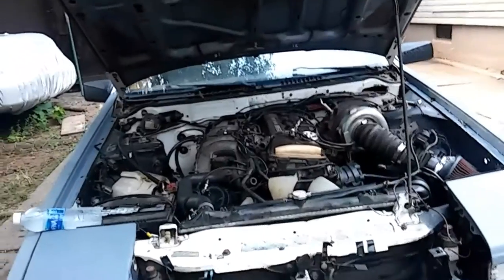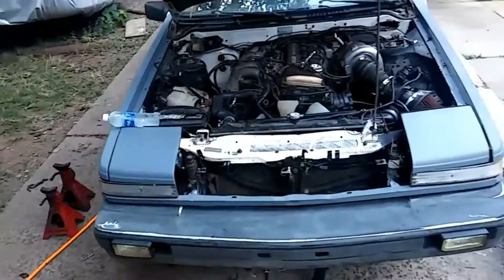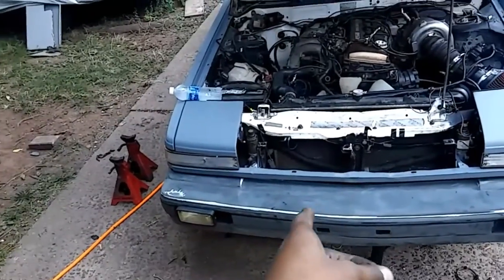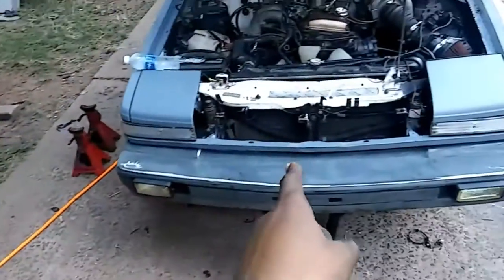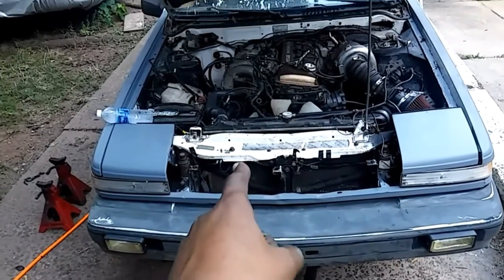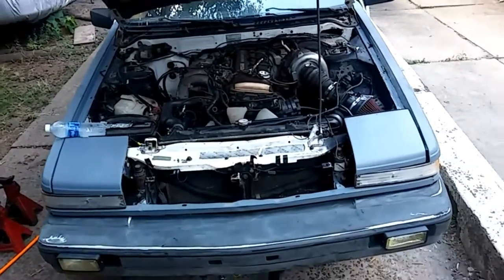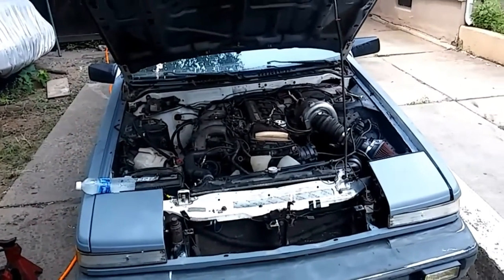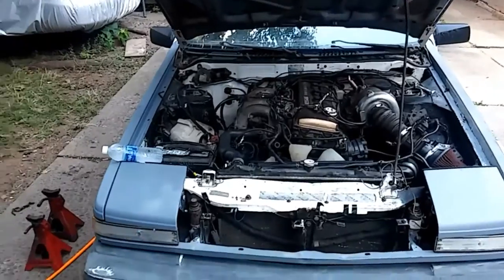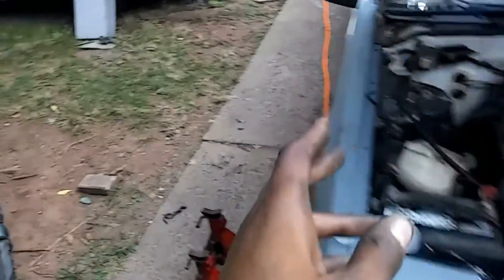Hopefully this goes well. I should be able to jack up the engine a decent amount once I put the stands underneath the car. I'm going to drop it up some more, put a stand underneath, and then get a block and jack up to the bottom of the oil pan — or actually put it behind the transmission so I can jack up the tranny and lift the engine a little bit, so I can use a small ratchet to get to those bolts on the oil pan.